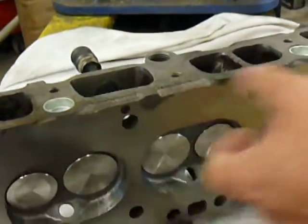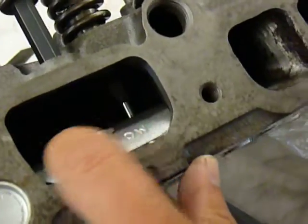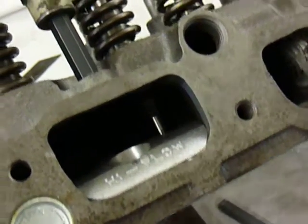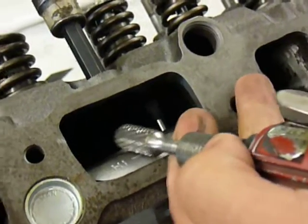You'll just simply tighten it down. After that's done, your screw will stick out of your port — you'll see it stick out a little bit. I've already ground on this screw so it tightens almost to an exact location it needs to be. You'll take your high-speed grinder and very slowly grind the head of that bolt down.